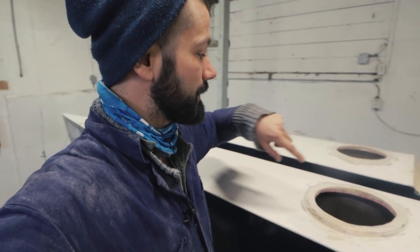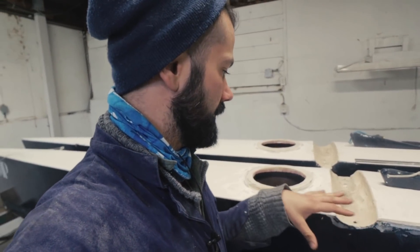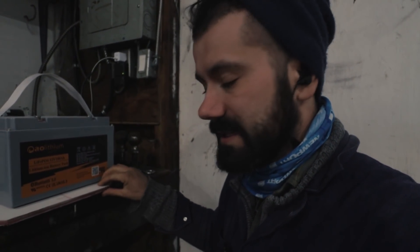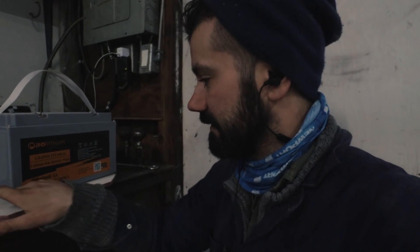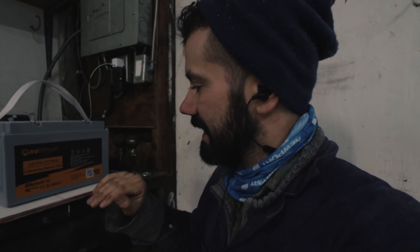There are our little inspection hatches slash cargo hatches — there's some junk from the original frames to clean out of there and we'll do that soon. But right now I'm letting the epoxy set. While it sets, there's another part of the project I'd like to get done: finding a home for my beautiful little AO Lithium battery. Because there's rotten plywood in there, I thought I shouldn't put more plywood in that boat — instead I'm going to reuse this chunk of deck that I cut out for the hatches. I'll cut it to size and give myself a little lip on either side and glue it to the inside of the hull, giving the battery somewhere solid to strap down to, raised a little off the ground so if there's water it won't slosh against the battery. 200 amps of 12-volt power is enough to do some pretty good welding, so we don't want it rocking around inside.